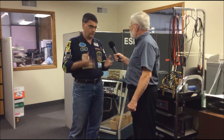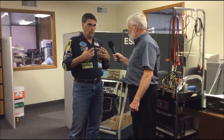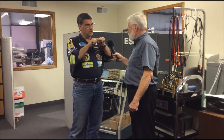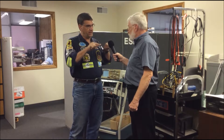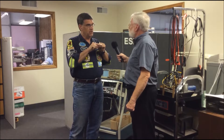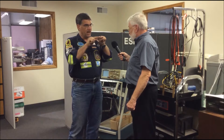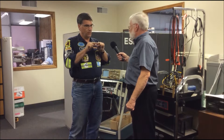By loading the circuit with a standard voltage drop test, or with the Load Pro tool I developed, what we're doing in effect is ohming out the circuit all the way back from the load — both positive and negative wires — all the way back to the battery. So in effect, we're testing the entire circuit with one test.